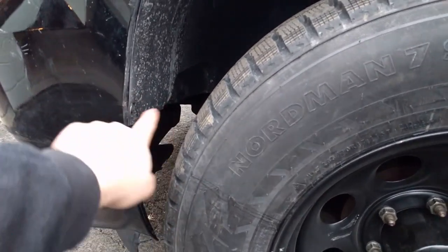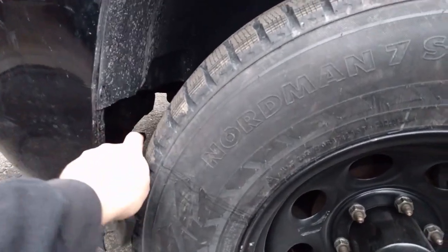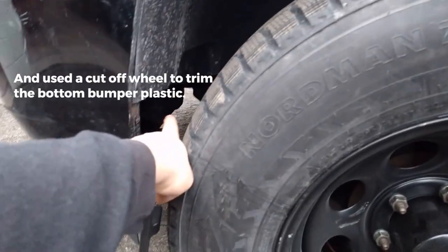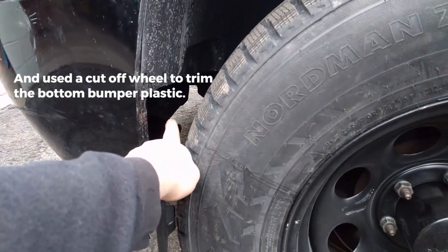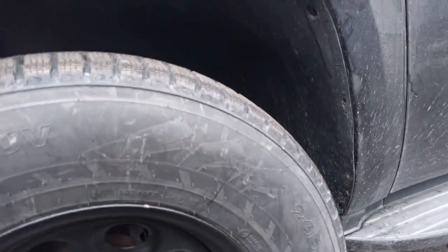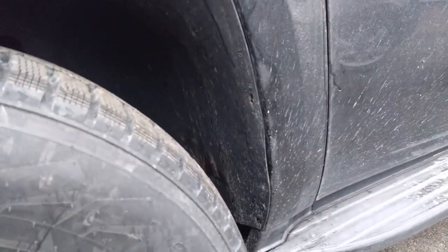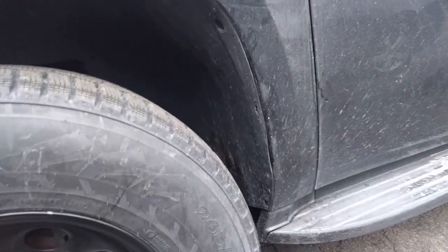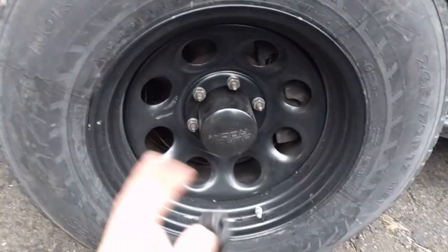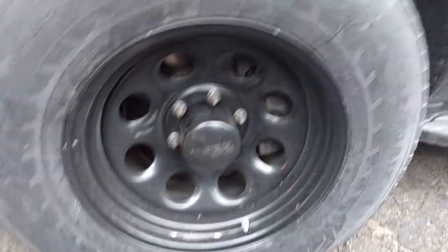I did a complete norcal cut — took the fender liners out and actually cut this one short. I may have to cut this one a little bit shorter; I think there's still a little rub, but it's not a big deal because it's flexible and it's only at full lock. I painted the bottom of the washer reservoir black. In the back I hammered some of the metal back rather than cutting it off, and did the same on the passenger side. The passenger side has got the fuel lines so I didn't want to use a grinder over there if I didn't have to.